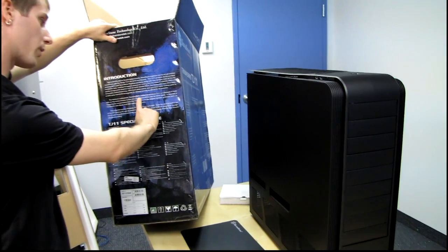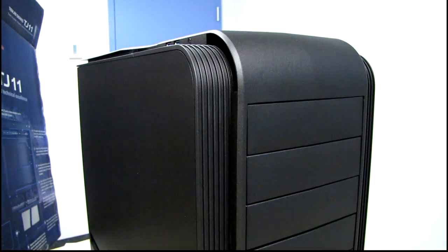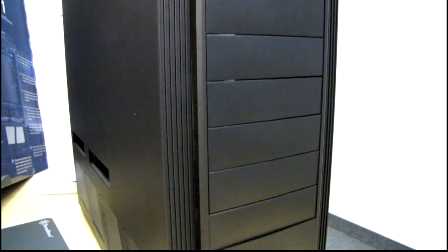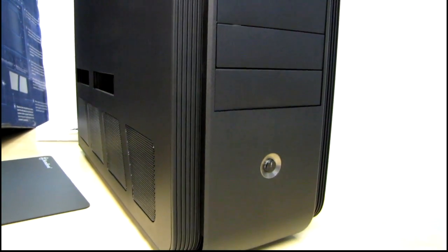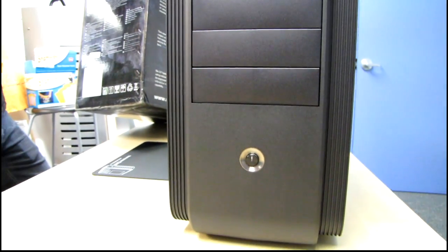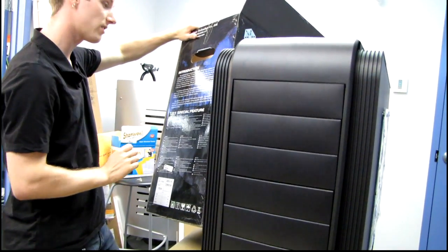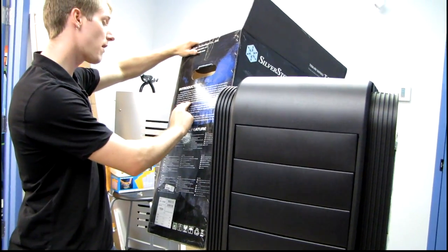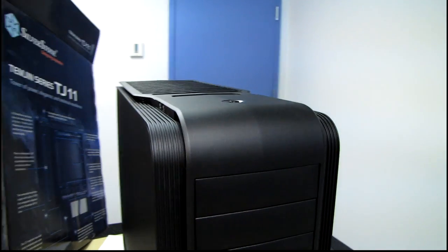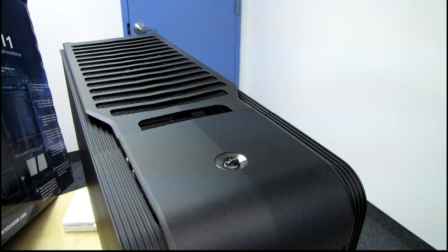You can completely take the TJ11 apart. It features a bigger lower compartment to house even the largest radiator available, and a potential and flexibility that are truly unrivaled — a thousand watt plus cooling capacity on air. You can build an impressive storage server with its plethora of drive bay options, or an amazing liquid-cooled build. It also has ergonomic touches: quick-access filters, hot-swappable hard drive bays — which the TJ07 did not have — a removable motherboard tray, a CPU backplate cutout, and optimized cable routing.